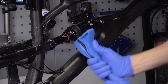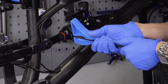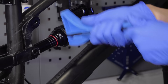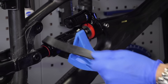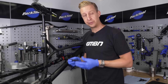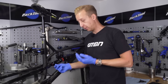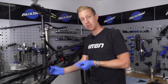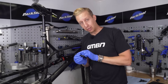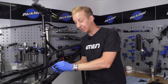There we go. Now if you're doing this in a vice, don't be surprised if the lower part of the tube spins as well - it's not a problem. And there may well be a little bit of a pop of just the air releasing when you get to the end of the threads. Nice and easy - no vice needed. Now for removing the shock itself, use a really high quality Allen key. Make sure it has a decent fit within those shock bolts. When you undo the Allen key, just take into account that your shock bolts might have quite a substantial amount of thread lock on them. So make sure the Allen key is located in there correctly, because if it slips, you're going to damage the head of the bolt, and that is not good because it can be very difficult to remove these.